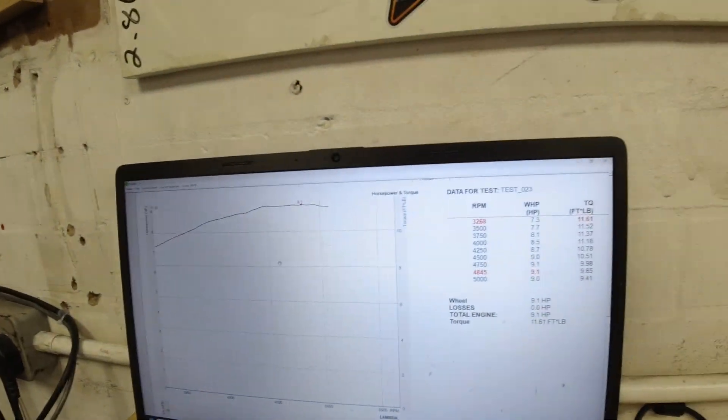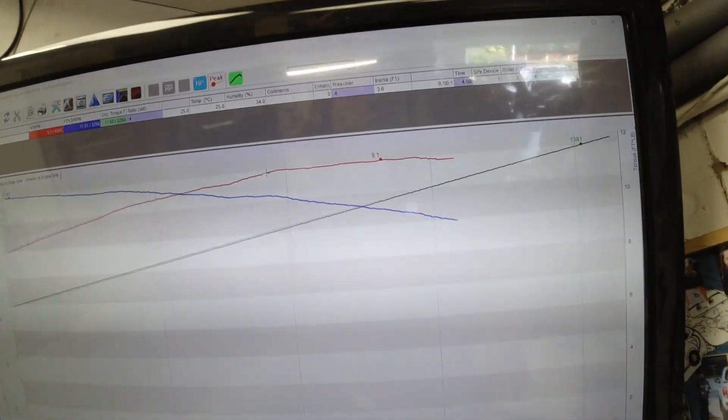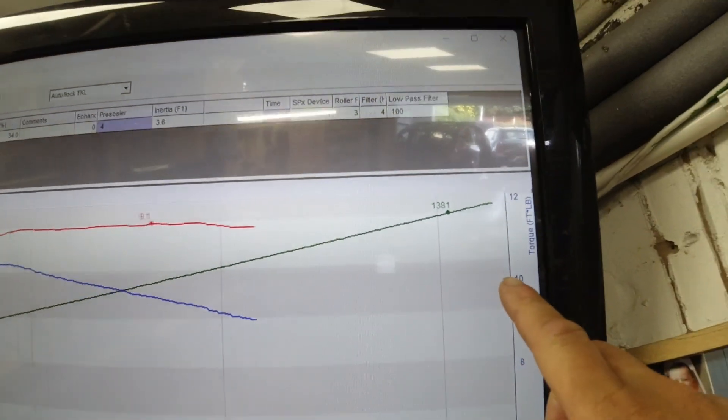It's got all the information I wanted. The roller speed at five and a half thousand RPM is at 13.8, which is well within the parameters of this flywheel — so that's safe. On my own engine I'll be revving to around eight and a half thousand RPM, which will still be well underneath the envelope of what the flywheel is rated to.